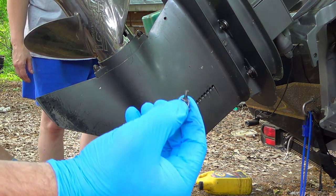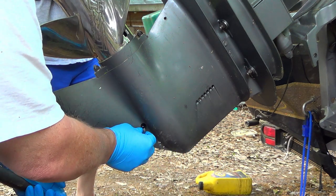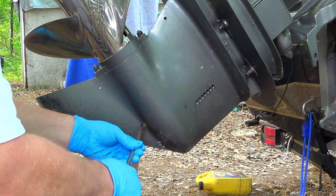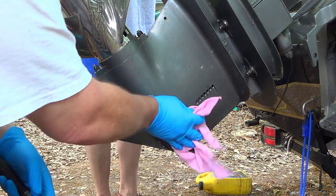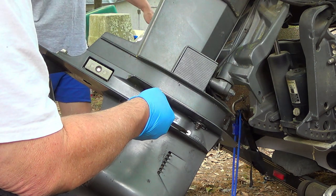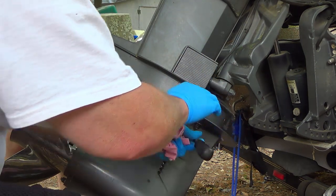There's a little magnet on the end of your plug here — make sure to check for metal shavings on there and wipe those off. There's an O-ring on it, so snug is plenty good enough. On the foot we've got a vent right here — I've got it cracked open — and here is your check. We've got to take this one out, then we'll fill it up with gear oil.